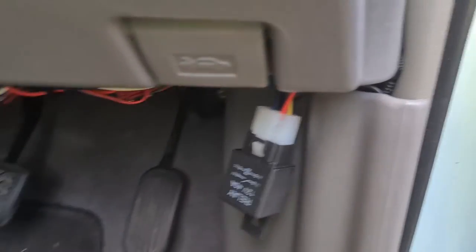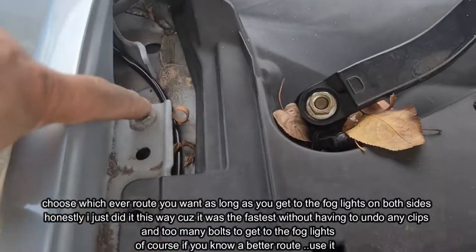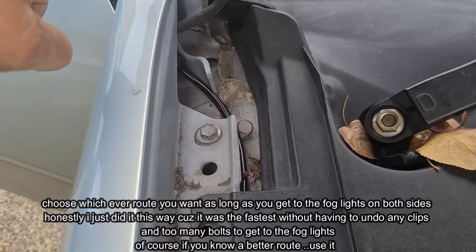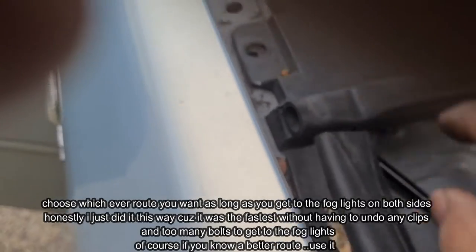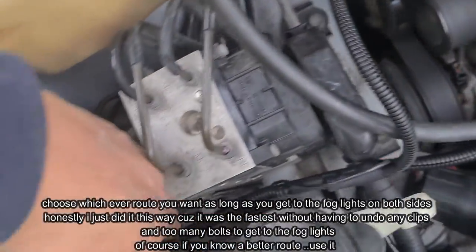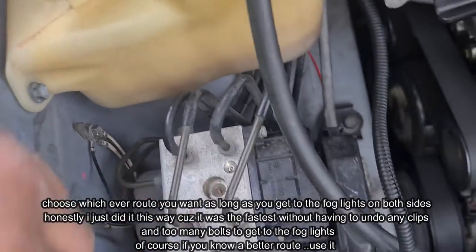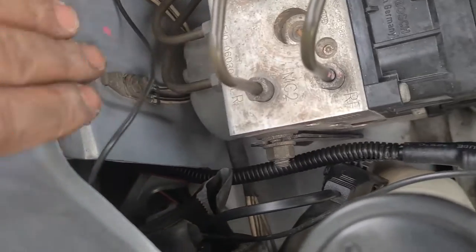I'll leave a link to this wiring harness in the description. From the front, I went through the quarter panel and came out here — I loosened this bolt, pulled the quarter panel back, put an LED light in the front to see where it shone out, then pushed the cable through with the green plug. I routed it under here and tucked it in. The grounding wire is grounded to a point just underneath the coolant reservoir. For the driver's side I tucked the cable down just behind here so it drops down to plug into the fog light.